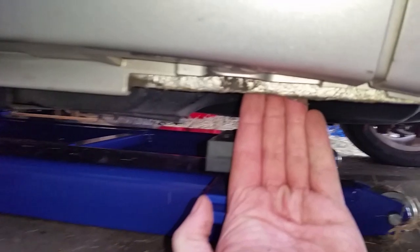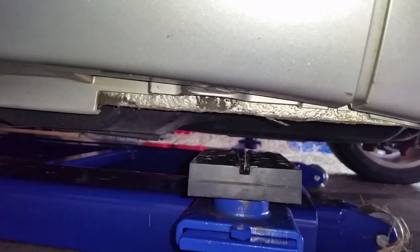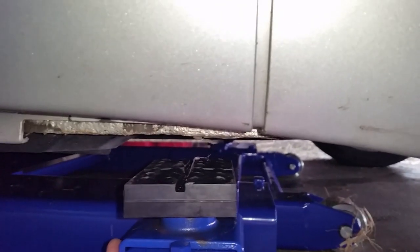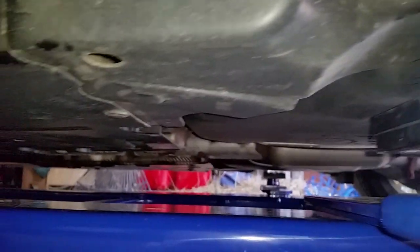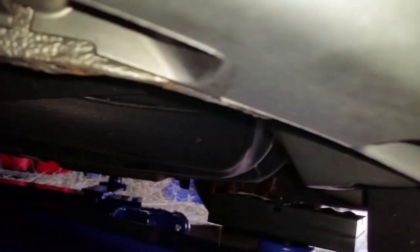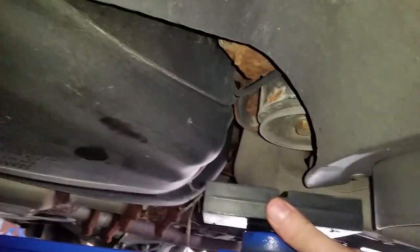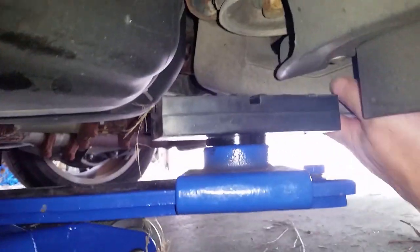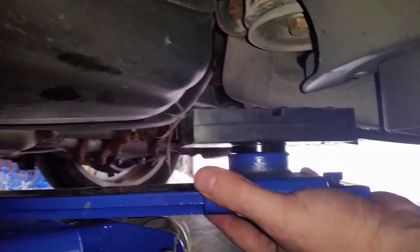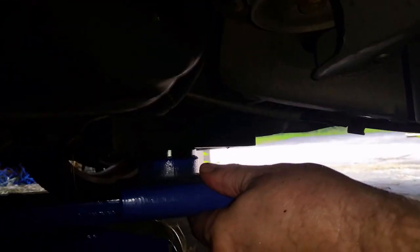And here we are again on the other side, and if anything this is even further in, so I can't hit the pinch welds. So it forces me to look for something inboard, and really there's nothing. I have a gas tank there, exhaust, I can swing these back, but they don't find much of anything. This is plastic, could eventually get to the suspension arm, except that now I'm against the end stop, so I would have to move it forward to get it any further back, which doesn't help me at all. Completely stuck.